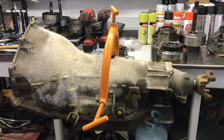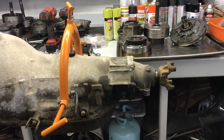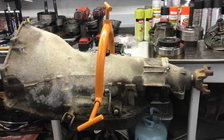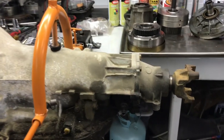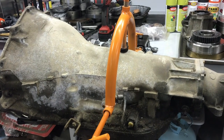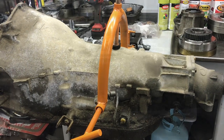If you have a four-wheel drive core and you want to make a two-wheel drive, it's a simple matter of changing the output shaft on the rear gear set when you have it all apart and buying a tail housing. So they're very interchangeable. They didn't change a lot over the years — they made a few minor changes, and I'll hit a few of them right now.